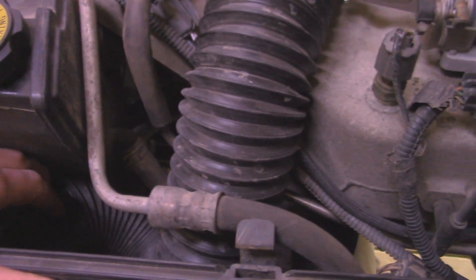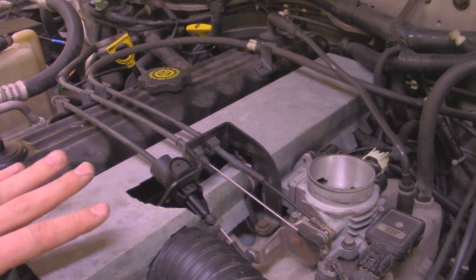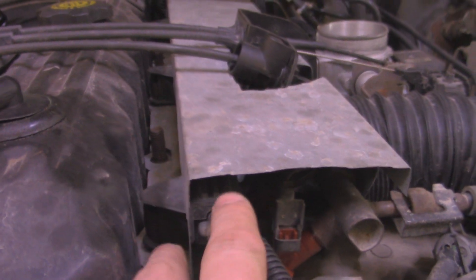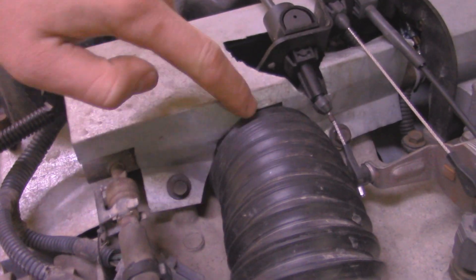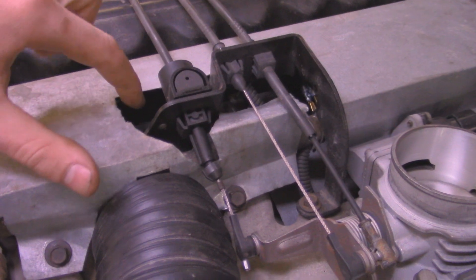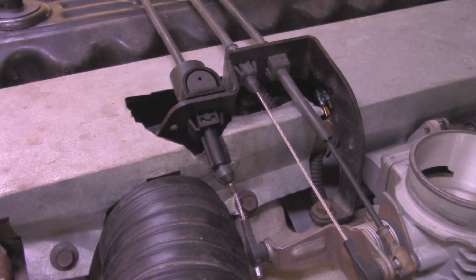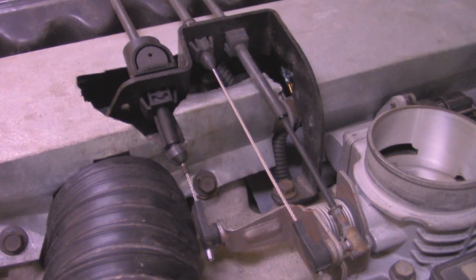This piping right here is just some generic stuff you can get at the auto parts store — I think it was like 10 bucks. When making the top shroud piece, it actually took a lot of work and a lot of test fitting. I made it so on one side you can use the factory wire harness that goes on top of the head bolts — it all clips in, so it's just sandwiched down there. I have three holes along there to have the wire harness stick through. On the other side, I basically just tied it into the fuel rail bolts onto the intake manifold, and I made a half circle there to hold it in place so it doesn't wiggle around. For the throttle cables, I basically just cut a hole so they would fit in there nicely. It is a little bit difficult to get to this bolt down here — I just need to get a swivel on there — but everything can still easily be accessed.